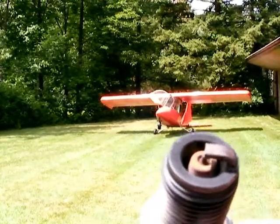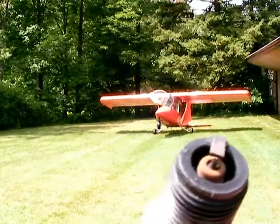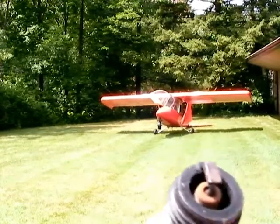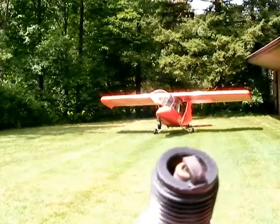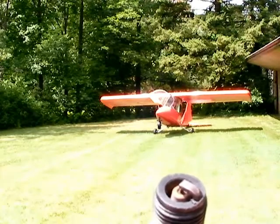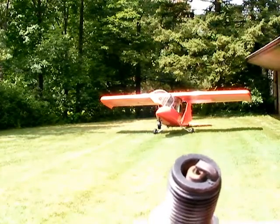The color of that insulator looks really good. It shows that this 447 is running pretty good. You want to have a nice, kind of a tan or a chocolate brown color like that. You just look at the insulator in there. That tells you how the thing's running. Then there's a little bit of soot around the shell here, which probably came from idling to go back to the hangar.